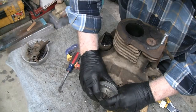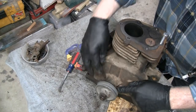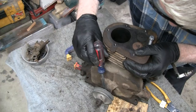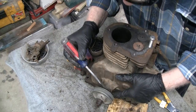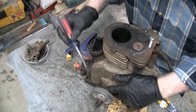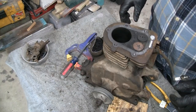Might have to get a puller for this — it's not even budging. Let me get that off of there and then I'll clean the shaft up. The shaft is packed with laundry detergent and stuff like that. Shaft looks good though — I scraped a little bit off and it looks good. So let me take that off, clean it up, and then we'll take the crank out.